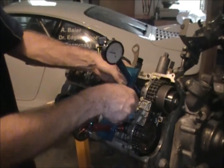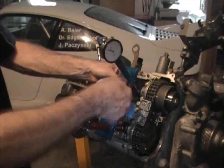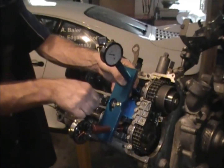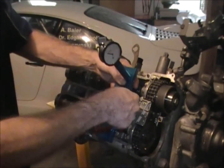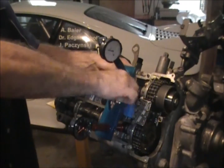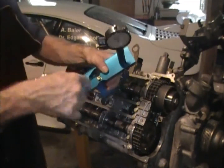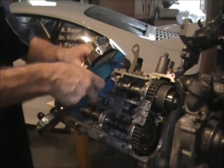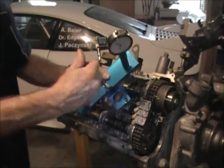There are small clips on the bottom of these Allen screws that hold them captive on the base plate. Just make sure that they're always in place and they're not loosening up or they haven't come loose. Once the base is free, you want to continue to loosen up the center bolt right here so that you can spin the base plate around. You'll see why that's important on the other side.